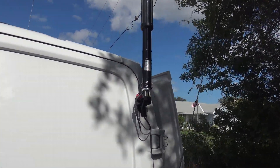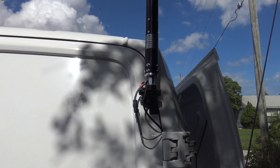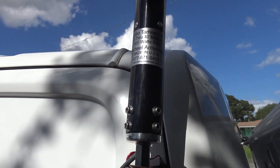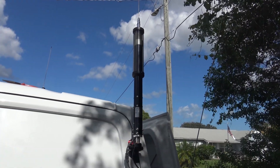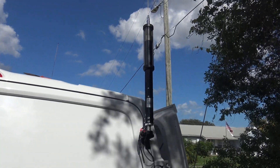This is the antenna I chose to mount on my vehicle — the little Tar Heel HP, 6 to 40 meters, handles 500 watts, and it's a motorized antenna. The higher you run the motor up or down, the antenna will be resonant where you set it. The more coil you add as it goes up, the longer the antenna is electrically going to be.